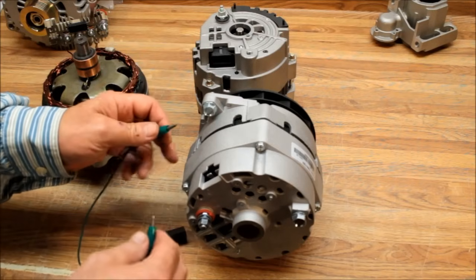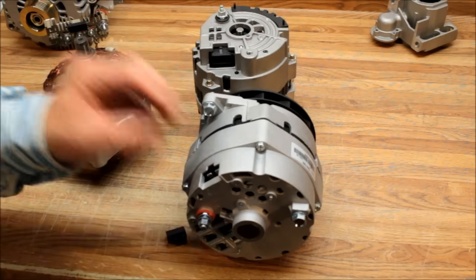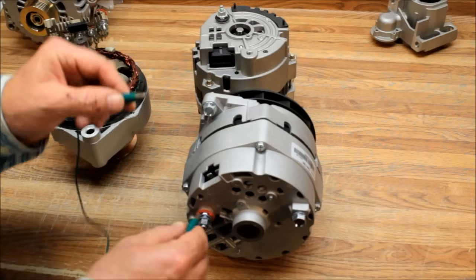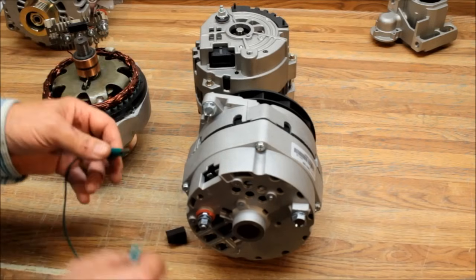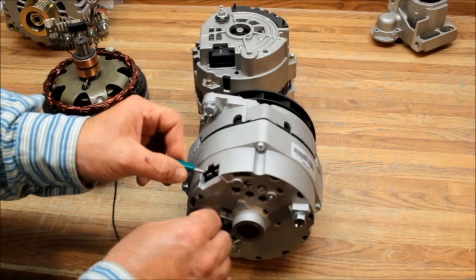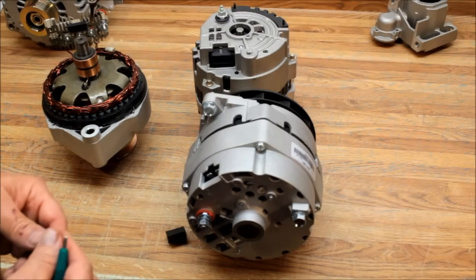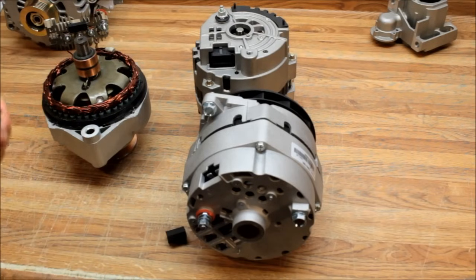You can put a push button on your dash — if your self-exciting alternator won't kick on, just pulse it. A regular alternator needs an ignition wire at all times, but with a self-exciting alternator you just touch it and it takes off. It'll spark a little, but it'll go and stay. With a non-self-exciting alternator, it'll run while the wire is on, but when you remove it, it quits — that's one way to tell the difference.